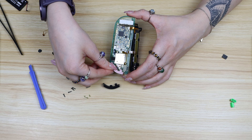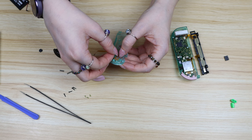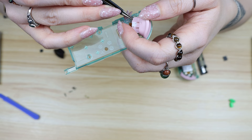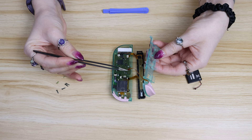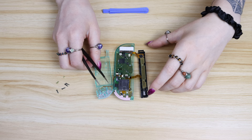There is a little knob here that you need to put that spring in. When you're putting the button into place make sure that the spring is sitting in the right place so that it maintains pressure or else your button's not going to work properly. That's all you have to do for the front plate. Now we're moving on to the middle section where you need to reapply the components for the ZL button. There is almost an outline made of plastic to show you where that component is meant to go and then it's just fixed with one screw. Put the springs back in before you click the ZL button back into place. There are two little knobs where the springs are meant to go — if they get dislodged you can jimmy them back into place with the tweezers. This ribbon cable is the last one we need to connect. Try and work with the bend in the cable rather than against it because it's sort of achieved by where it naturally sits inside the Joy-Con and you don't want to break the cable.